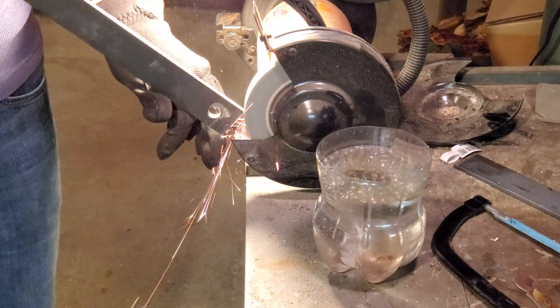Right now, around the perimeter of the trailer, there's absolutely no method for attaching any kind of loading straps or safety paraphernalia to keep your cargo secure. I went out and bought a bunch of D-rings. This particular one is made by Keeper - they're one and a half inch D-rings rated with a 1,600-pound working load limit and a 5,000-pound break strength. The working load limit won't really come into play here because I'm putting them onto wooden deck planking, which will be a lot weaker than these steel D-rings. The only thing I anticipate using this trailer for is loading my John Deere lawn tractor.